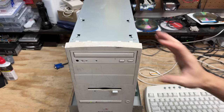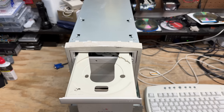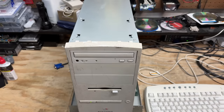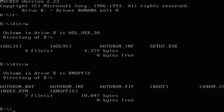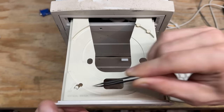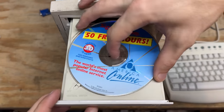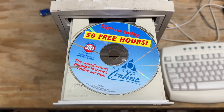I'm very curious to see if this thing reads CD-Rs — it probably does since it's a high speed drive. This might be a later addition to the system. Oh, I think it likes it. And yes, it does. Okay, that's awesome. And here's something you never see anymore — this is the vertical switch. That allows you to mount the CD drive on its side while still being able to put the disc in the tray. So let's engage that — it holds spring pressure against the disc, so you push it against there, and then it butts up against these rubber bumpers. They sure had some clever tricks back then.